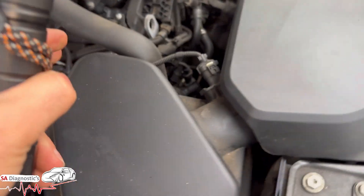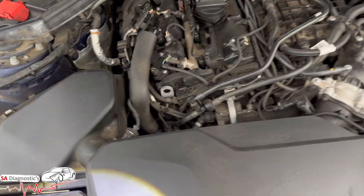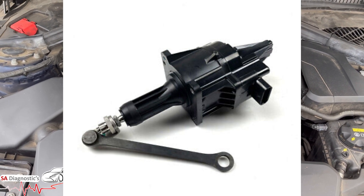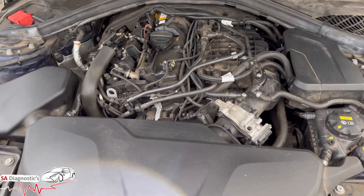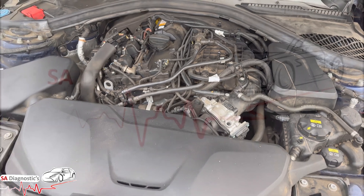It's not hard — it would be very easy. Just get rid of this and this, and your hands are literally there. Make sure the engine's not hot otherwise you're going to burn yourself. This is what the component looks like — just get one and change it. If that doesn't help, then the next stage would be the turbo itself — that's what we would recommend.